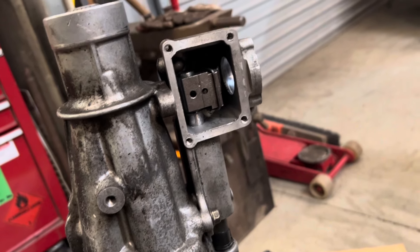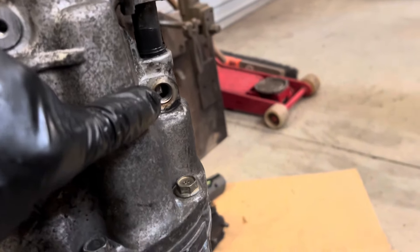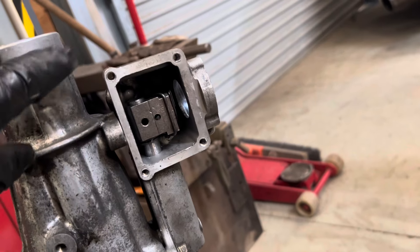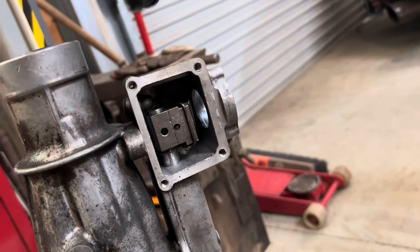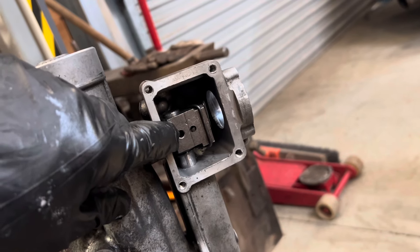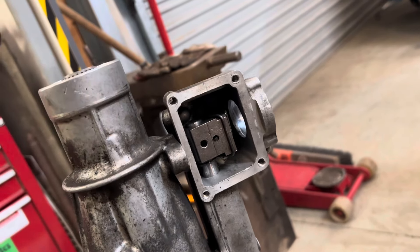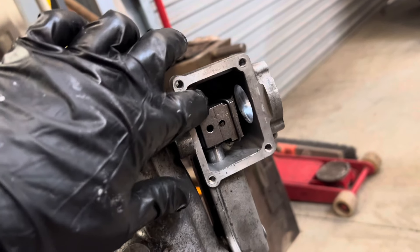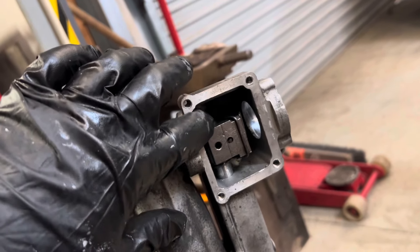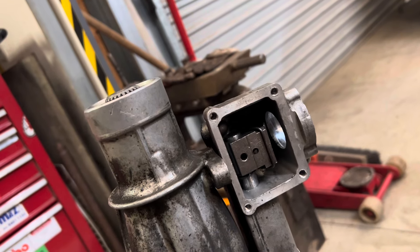So I just managed to get the shifter housing on. I left the neutral switch out so I could see the notches in there and make sure that the shifter rod didn't move when I put this bit back on. It comes in this side and that pivots around and changes gears. There's a split pin that goes through there, so to remove the shifter housing you've actually got to put this on as one and take it off as one. Same as when you put it back on - you get it so that rod's just sticking through, put this on, then push it all home together. You've got to make sure that doesn't drop in and knock it into gear or fall out of the gear selector.